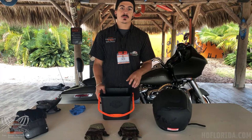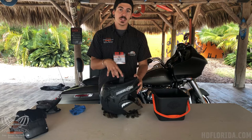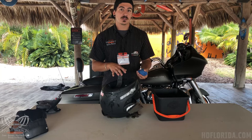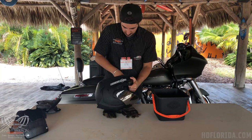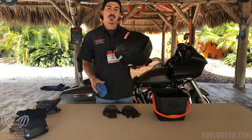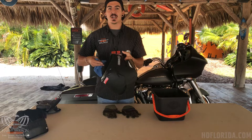Now I'm going to clean the inside of my helmet. I would recommend doing your helmet thoroughly before starting on anything else. For the EPS — the inner foam — you don't want to use anything like aerosols; it might be too abrasive. The best thing you can use is a mild soapy water solution. Thoroughly wring out your cloth — you don't want to saturate the inside. Wipe down every surface you can think of, especially the front mask area because that's where you'll be breathing. Set it aside to dry, open up all the vents, and make sure you're not doing this right before you go riding because putting everything back in while it's still damp could create problems.